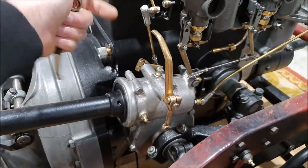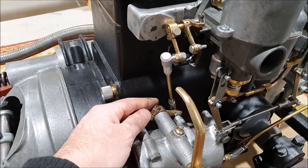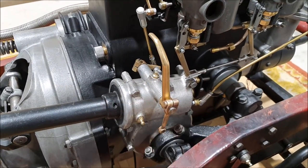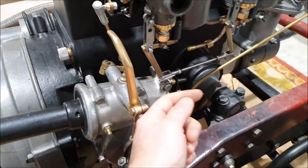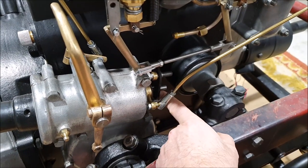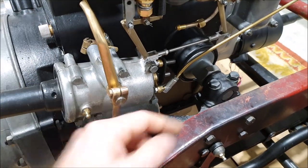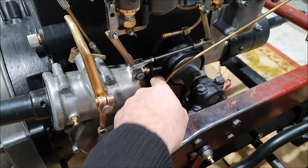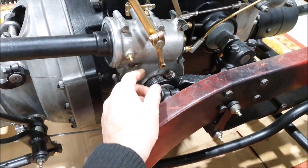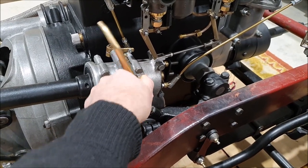To actually get it in place I need to take the steering box out because you have to poke it through from that direction. So this is just a temporary setup. You can see there's an arm on the back that works the throttle — that comes all the way through, and if you imagine the arm is where it's supposed to be, the end of this finger then runs effectively on the end of the shaft, which is one of the controls that comes through. It's two concentric shafts, and there is a cam that lives on there. When you rotate that control, the cam — if this finger is resting on it — will lift the throttle up just a little bit.